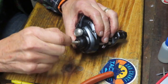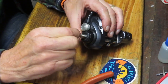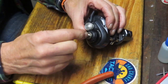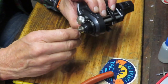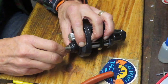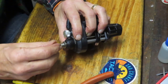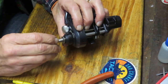And actually, I missed one there. The first one goes in. The cap washer first. And we put that keyed one on. Then we bring our, this is your adjuster screw controlled by the star adjuster. Just make sure you got it started right. This one's not. You got to make sure that you don't cross thread. This one's not cooperating. There we go. There we are.